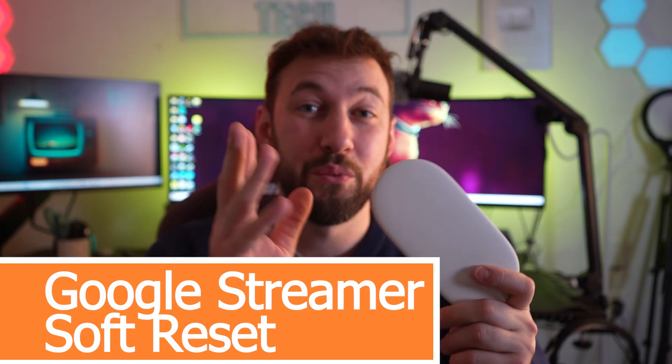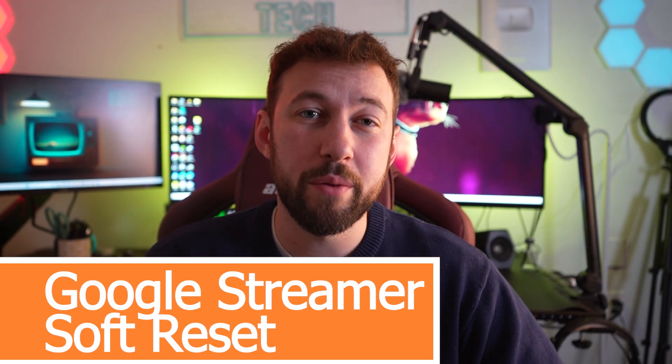So let's start with a soft reset. Typically, our streaming devices while they're plugged in never actually turn off — they just go to sleep. So the first thing we want to try is something called a power cycle. This involves turning off your device completely and unplugging it for five to ten minutes, basically resetting it. This does not affect any of your data and will not remove or ruin anything you have installed on your device.